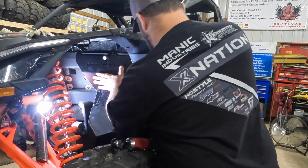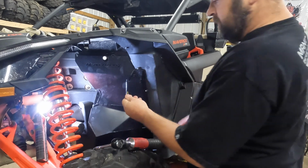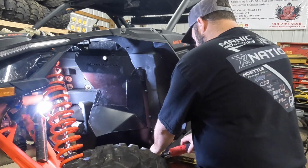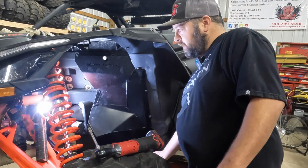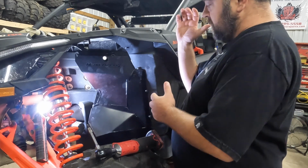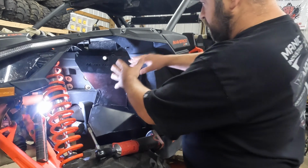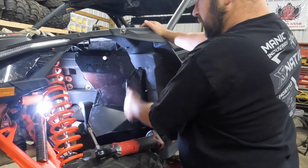Now these 2 are going to hit the rivets with your washers. And then again, the smallest bolt goes in the bottom hole here. Now there are 4 rivets that we have to drill holes on the bottom. So we'll get these all lined up into place, and then they want you to put pressure up on there and drill them as flush as possible, which right now it's pretty flush to the bottom. So we'll get these in place first, get everything all sealed up nice, and then go on the bottom, drill out 4 holes, and put those 4 rivets in.